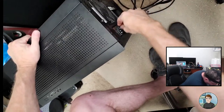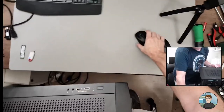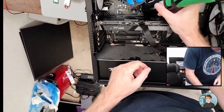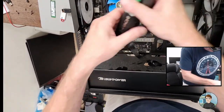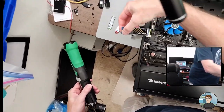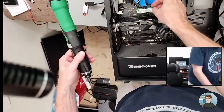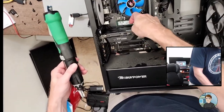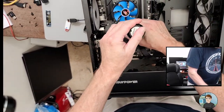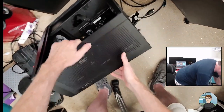Disconnected. Cables aren't long enough. We'll leave the mouse and keyboard plugged in. Alright. Okay, so we are removing the client's M.2, which is a MSI brand M390 500 gigabyte. We're going to put in this Samsung 1 terabyte. Okay, that's in. We're sticking with one stick of RAM, because it was blue screening with all three RAM sticks we tried.